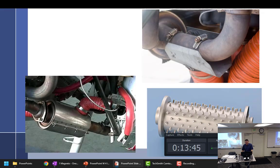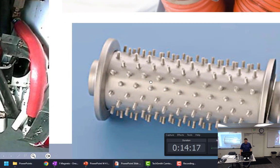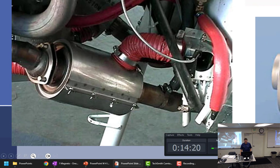There are different styles of heat muffs. This one is definitely for carb heat, not cabin heat. Here we have just an exhaust pipe with a scat tube - or skeet tube - coming up through. There's usually a mesh screen down there; if it's missing, check where it went - you don't want it going into the engine. This is just a shroud that draws warm air across the hot pipe and sends it off into the carburetor. Sometimes you get an actual heat muff that surrounds the exhaust; one side might be cabin heat and one side carb heat.